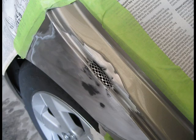The reason for applying a self-adhesive metal patch is so the body filler will stay in place and won't fall inside the hole. I cut off the right piece of self-adhesive metal patch that exactly fits into the hole. Any excessive metal patch could be sanded off later during the sanding process.